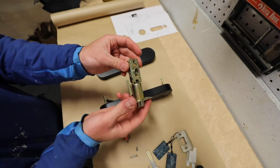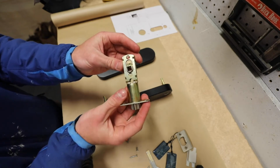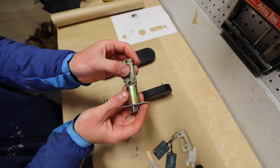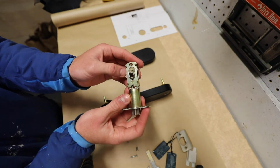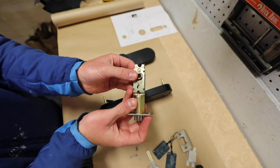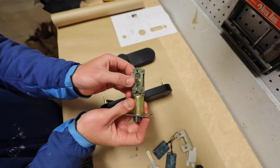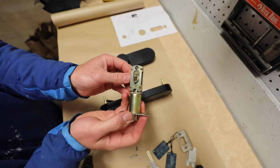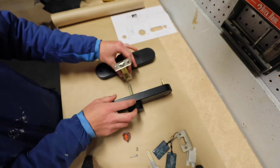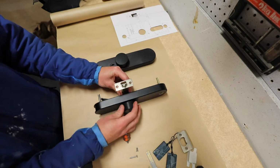We have what looks like a very standard door latch. It has even marks in standard and metric, 2 3/4 inch back set and 2 3/8 inch back set, 60 mil, 70 mil. You can adjust how deep the back set is if you're installing this on a door that has previously determined holes. Now, I want the thinnest back set possible because I don't have a lot of room to work with on my door, so we'll leave it at that, but I'm not installing it right now. So we'll slide this on our tube here.